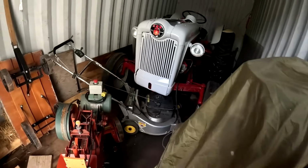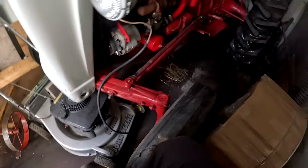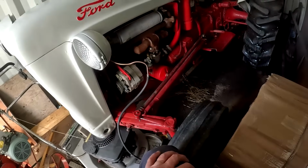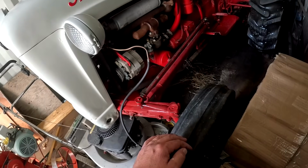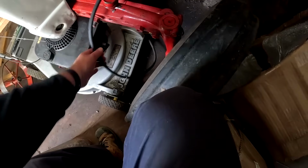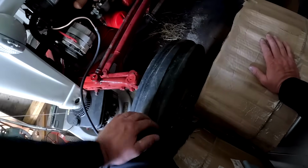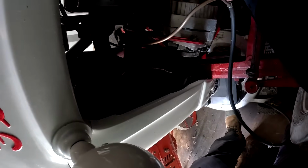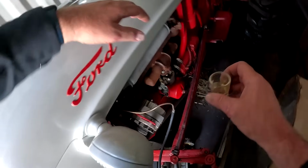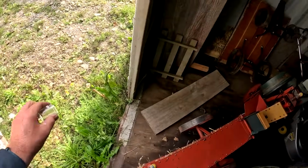Still smells like gas though, and I drained it all out. It's got something going on with the needle and seat still on this thing too. And whoa, Nelly. I drained it all out because I think it needs it, and we've had that carb open many times. There's a bit of moisture on it though. I still see a little bit in that sediment bowl though. So probably should just get that right off, to be honest. Put this on some weeds, like these ones.